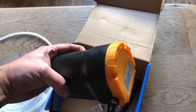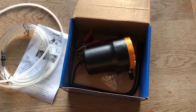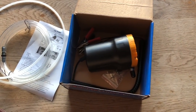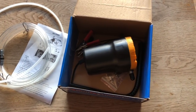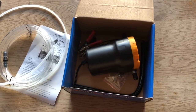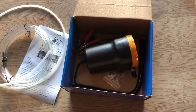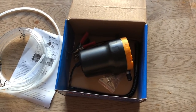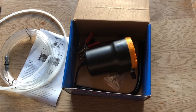It's a pretty slow pump by all accounts looking at the flow rates indicated on the docs, but it'll eventually suck everything out in one go. It's actually not a bad method because you can control when you start and stop it. Considering there's nearly 10 litres of engine oil to come out, if you've got a container that's only 5 or 6 litres, you can stop it, empty it into another container and carry on again — which you can't really do once you've undone the sump plug.